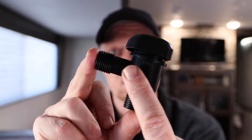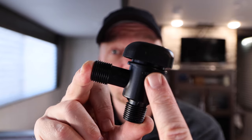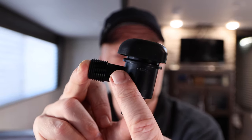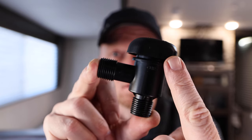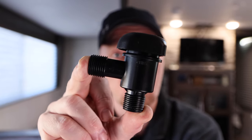So how did the water get into my RV? When we turned the water on, it was going toward the black tank. What happened is that the diaphragm inside got turned and allowed the water to push past it and come out of the little vent top. When the diaphragm releases to allow air into the line to prevent siphoning, there's a little air gap underneath the hood — and when that diaphragm got kicked, it allowed water to escape through that vent, pushing water inside our RV. Once we troubleshot and realized we could stop it, we didn't worry about the next campground and just stopped there to deal with it later.